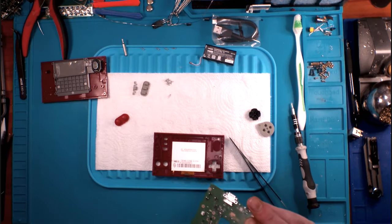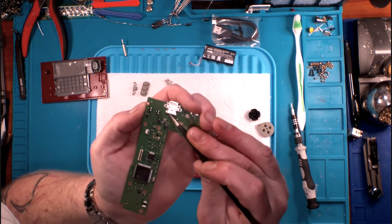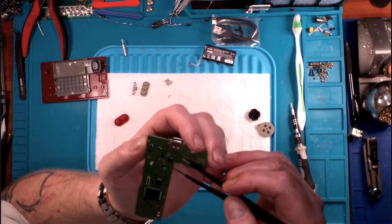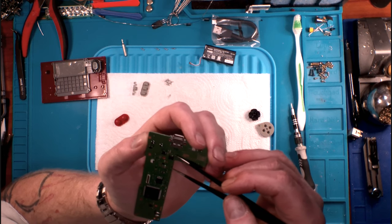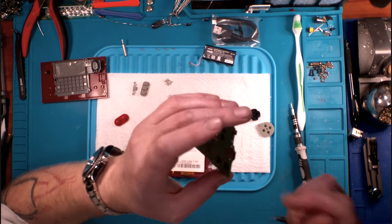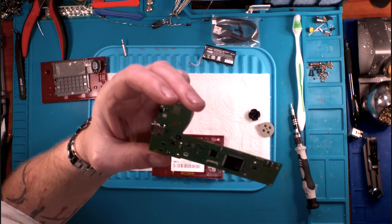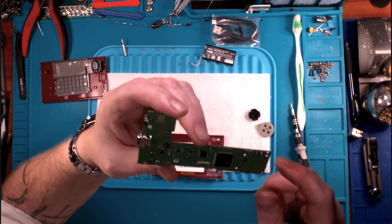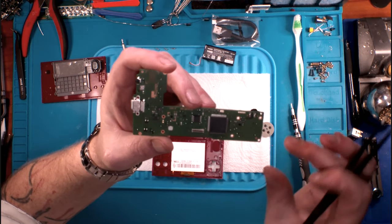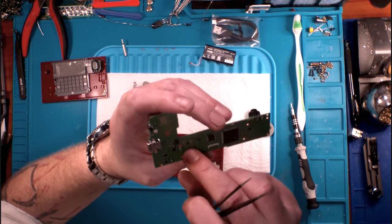So interestingly enough, on our USB-C charge port, there are no data lines coming in. There is only a charge line, positive and negative, coming in. That's all you get. This USB-C is only for charging. There is no way to pass data in and out of this, which means the only way to program our chip would be on a NAND reader, where you set the whole chip down, program it, and then assemble the whole board around it pre-programmed. That's what that means to us.